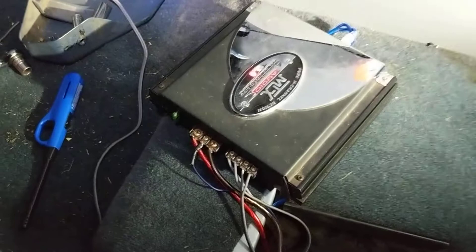So far there's definitely a difference. The install was pretty straightforward as far as stereo installs go. We've got our power wire here coming off the battery, and I've got it going around the air box kind of against the body. I'll end up zip-tying it again — we haven't cleaned things up yet — but it's going back over near the air intake. I just ran it right through this little rubber boot here so I didn't have to cut any holes in the firewall.